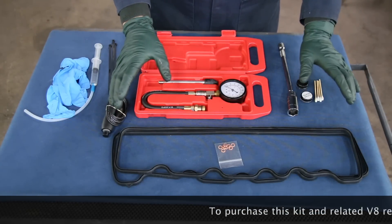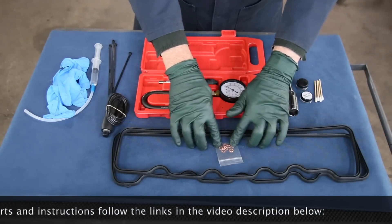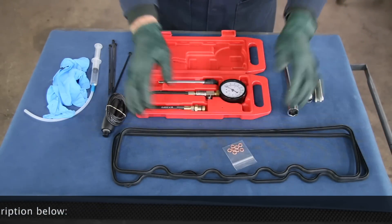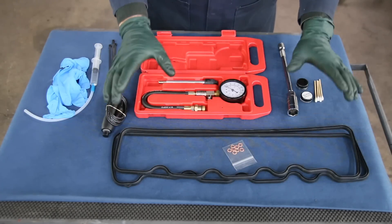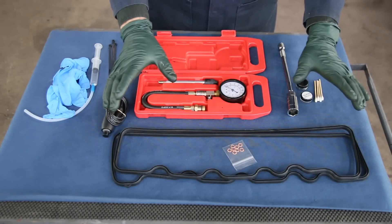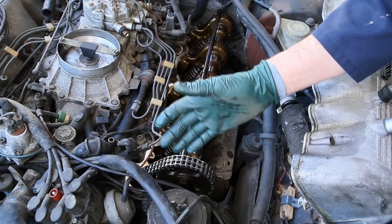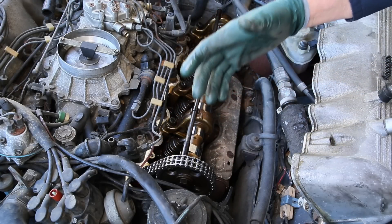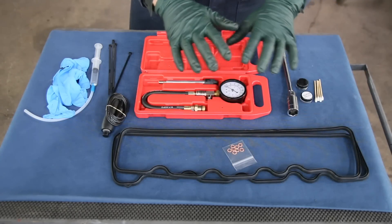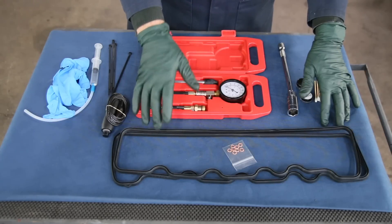First, you're going to open up the valve covers, which is why I include new valve cover gaskets and new bolt copper sealing rings for when you reinstall them. When you open up the valve covers, they'll give you a real good clue on how well the engine has been maintained in terms of oil changes and whether there are some major problems brewing. I've often said the valve train on these engines is kind of the Achilles heel, so you need to pull the valve covers immediately. My instructions will walk you completely through what you're looking for — there are three or four different things to check inside the valve covers.